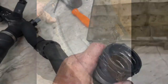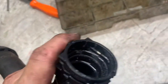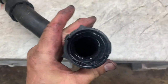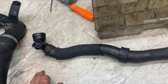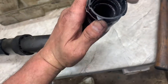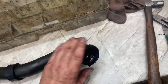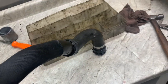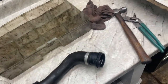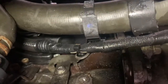Next are cooling hoses — put your clips in. This is the lower one, and you've got to plug that in also. Make sure your O-rings are in there and make sure they're clean. They give new ones with the pump but double-check them. Don't forget to put that screw in the bracket because that holds the lower hose.